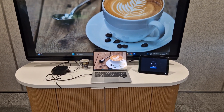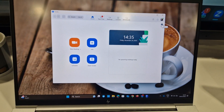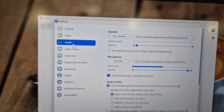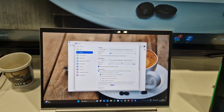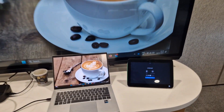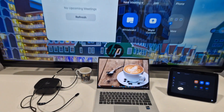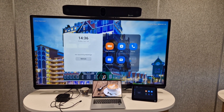Now the X70's camera, speaker, and mic are shared with my laptop. In the Zoom client, under video settings, I can see the X70 camera, and under audio settings I see the X70 speaker and X70 audio. When you're finished with your meeting, go to the touch panel and switch back, or simply unplug the cable to exit device mode and return to native Zoom. Thanks for watching and hopefully see you back in the next video.